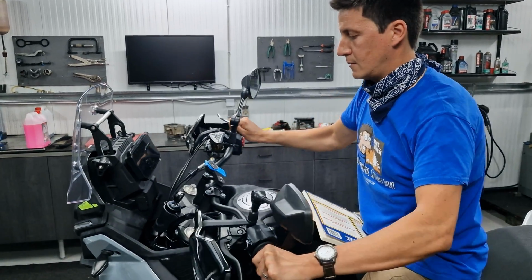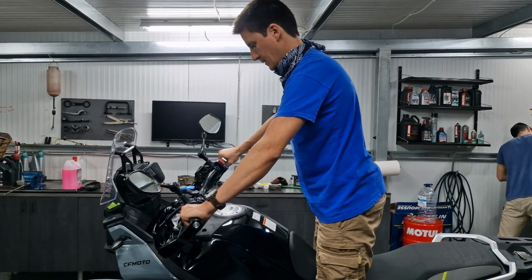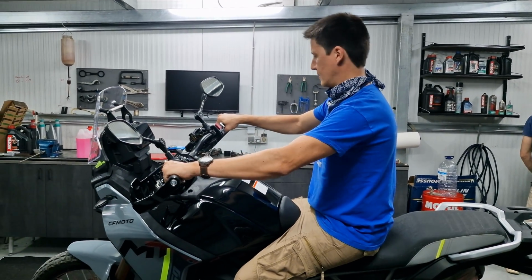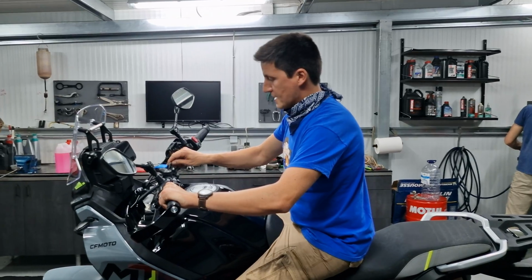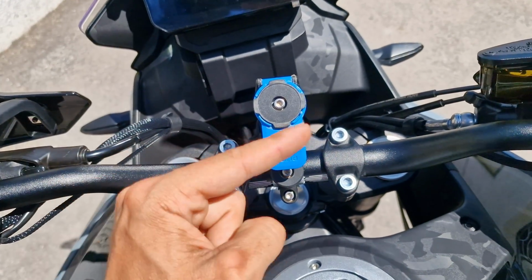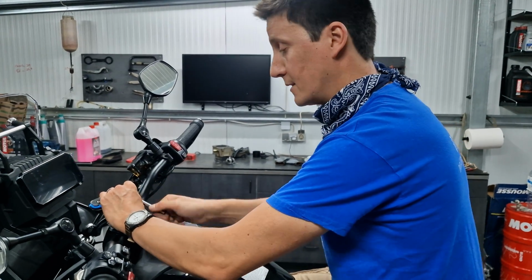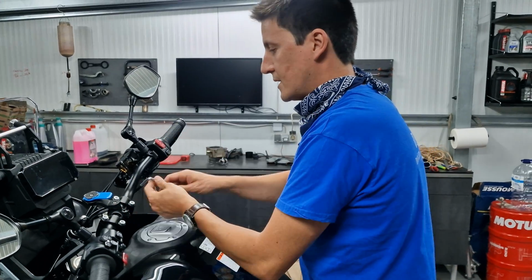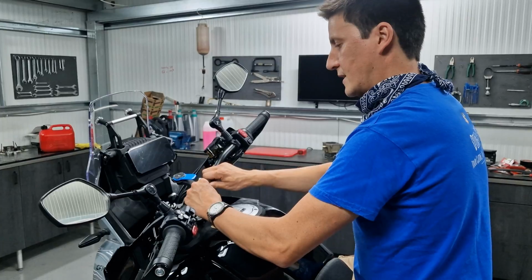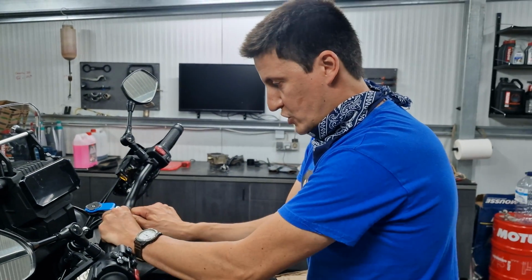And feels good. When I'm sitting, it's a little bit too aggressive, so let's find a middle ground. Done and done. I usually tighten the top bolts first. Not entirely, not until it's up to torque, but I tighten it to, let's say, 90%. And then once it's done, I tighten the lower ones. And when they feel that they are at 90%, I go back to the top ones and finish it.